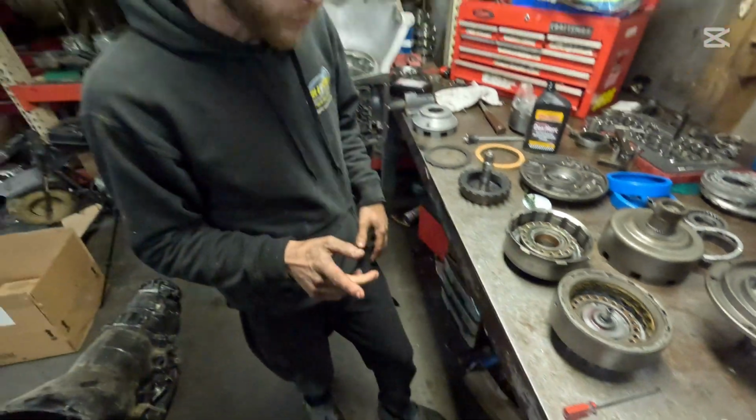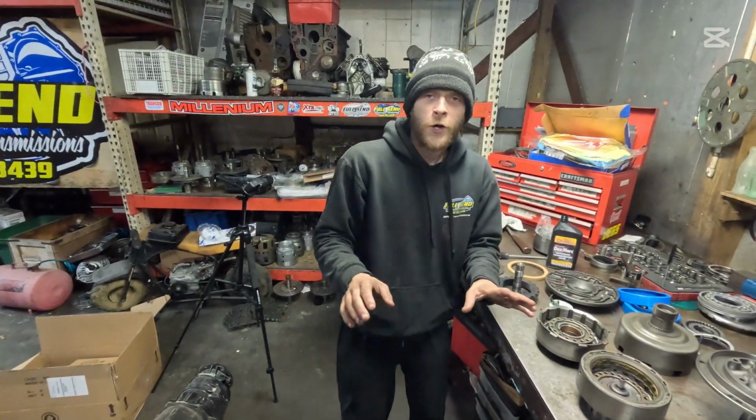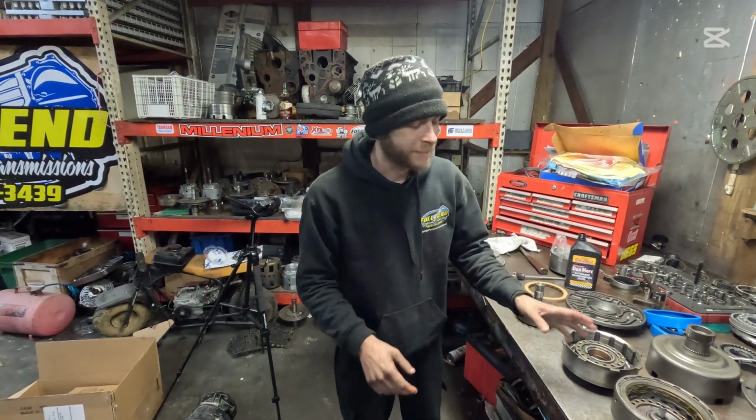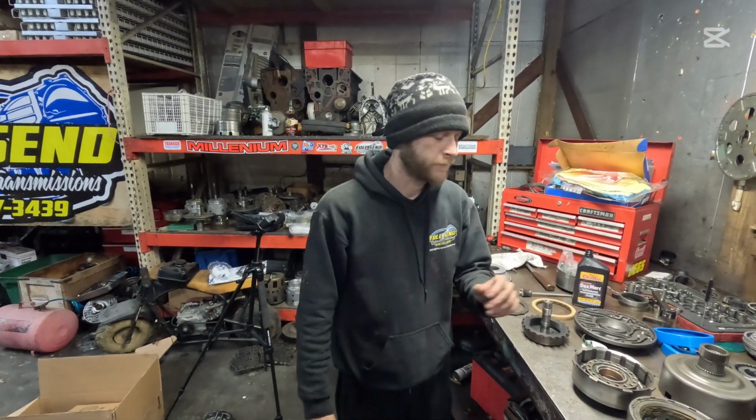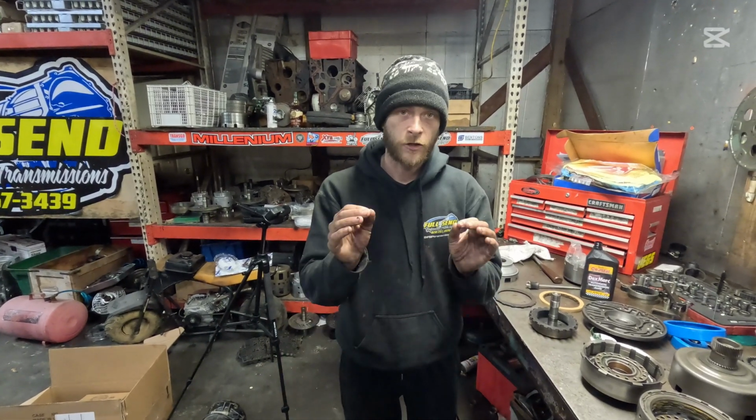Now, a lot of you guys are going to be like, bro, you just put your clutches in dry. It doesn't matter with the Turbo 350, and for that fact, I've built 68s dry, I've built 700s dry, I've built 4L60Es dry. As long as you break these things in on the lift, I cannot reiterate this enough to all you clowns out there on the internet. If you break this in the proper way, which you're going to do anyway, nothing is going to fail. How are you going to ship a transmission that's full of transmission fluid?